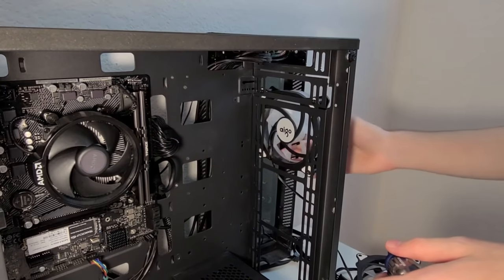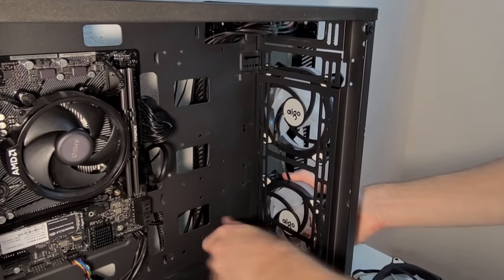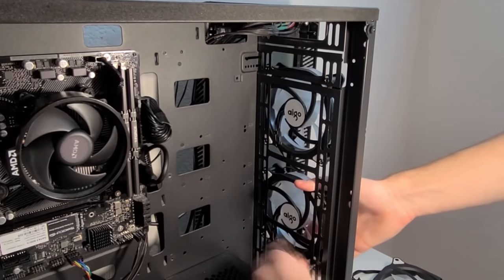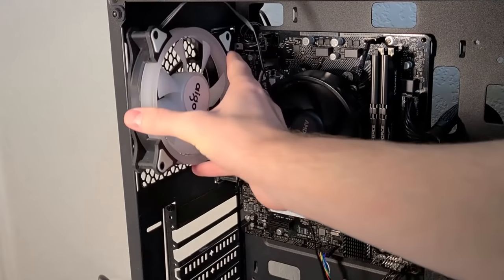Now the fans I'm installing right here are not gonna be the ones that I link to you guys in the description. These are just leftover light up fans that I have, but I will be linking much better ones in the description. They're pretty much identical to these. And again, the installation process is the exact same. They fit in the exact same slot because they're 120mm. Same exact procedure for the fan in the back of the case.